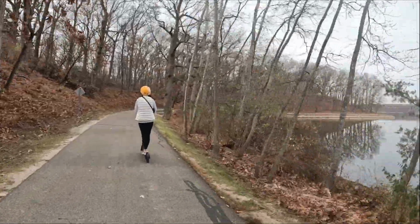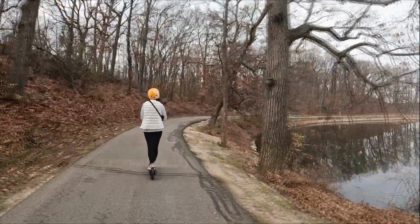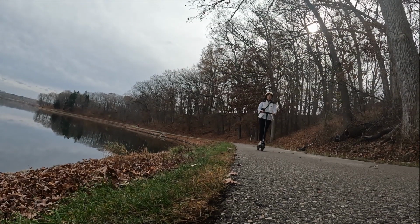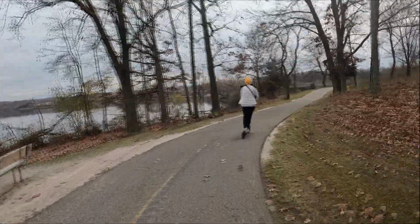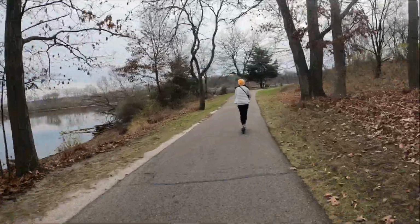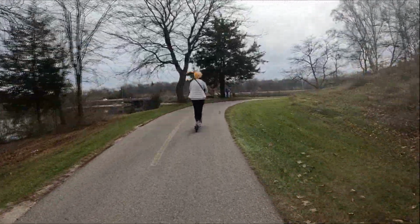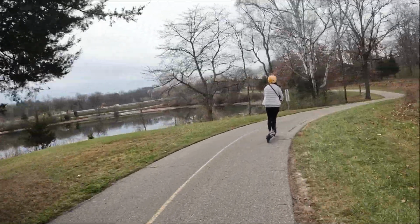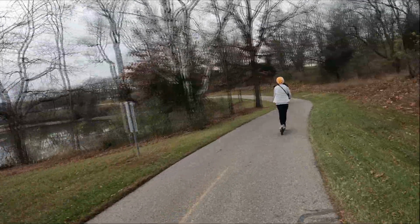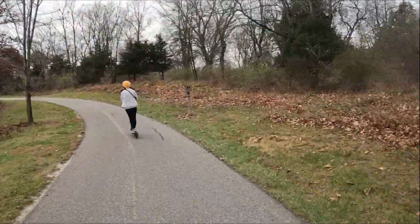The S2R has a cruise control that will automatically activate if you hold the throttle in one position for several seconds. This is one of the best features on the scooter and also one of the most annoying. If you hold full throttle for several seconds, cruise control kicks on at whatever speed you're at after a few seconds. For me, that is usually around 13 miles per hour when I start from a standstill. If I'm in mode 1, that's great since that is near the top speed. If I'm in sport mode where the top speed is 19 miles per hour, that's a problem.